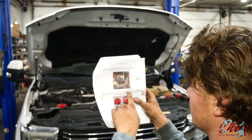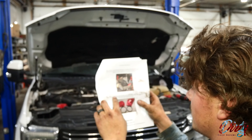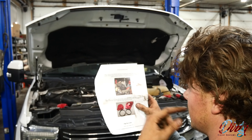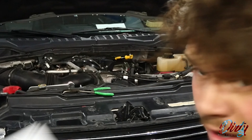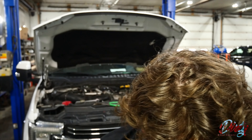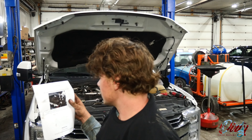Put the small o-ring onto your flow-through plate — use a bit of grease to hold the small o-ring on the plate to aid in assembly. Note: the big o-ring will only fit the correct piece, but the small o-ring will fit either, so take care to get it right the first time. This smaller piece is the small o-ring side; the other is the big one.